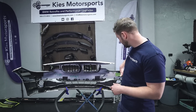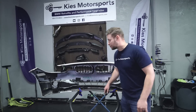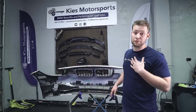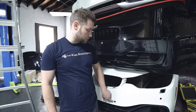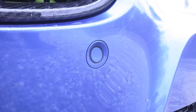In addition to the side camera and PDC holes on the side, BMW actually marks all of the holes on the inside of the bumper. So if you're doing a PDC retrofit, all of these holes are pre-marked, whether it's on one of these bumpers or one of ours. Something to be careful with: make sure you have the right size hole. On a base bumper the front and side holes are all the same size, but on most M Sport bumpers the two outer holes are smaller and the two inner holes are a little bit larger.